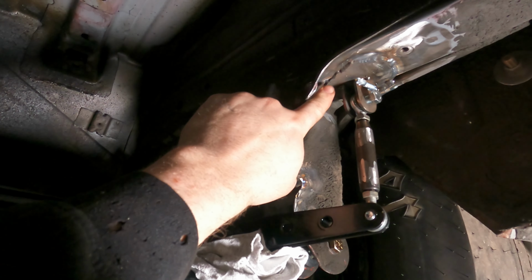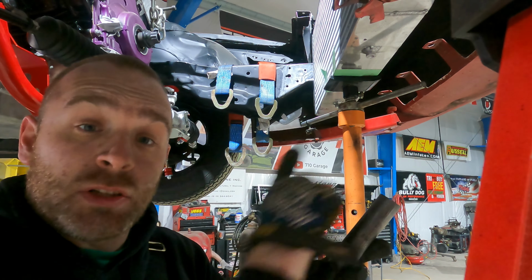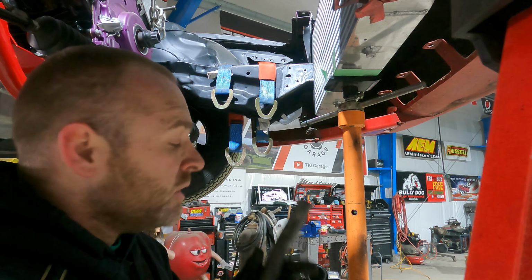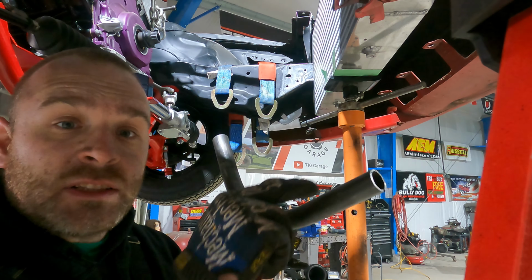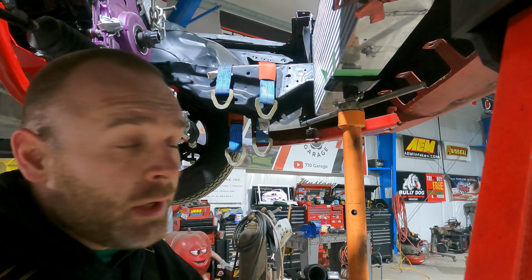Okay, so we know roughly that we're gonna lose this 3 inches, but I can't lose that until after I bend it. We have to bend it and then cut that off, since that's how much I need to grab in the bender to start that bend process. So what we're gonna do is measure this guy, we'll measure across, we'll measure up, we'll cut a piece just a little bit longer and start bending.